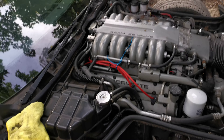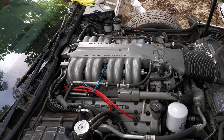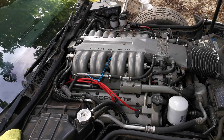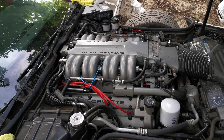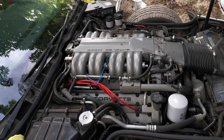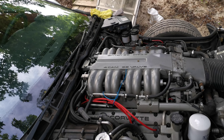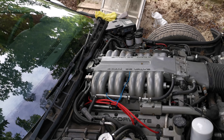I'm looking for a miss in this engine. I took the plenum off a few times, checked the fuel injectors, compression, and all that. I had put new plugs in — the guy had oil all in the cylinders especially on one side. The other side still had the old plugs and didn't have oil in it, but the plugs turned black. I cleaned them and put them back in, chasing the miss. When you're working on cars, do the simple stuff first — check everything, double and triple check it.